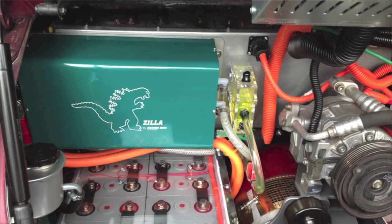One of the drawbacks of doing a conversion is that very often you end up with extra gauges on the dashboard that are not connected to anything. To that end, I volunteered along with my friend Deb to help Kirk get this running smoothly and more integrated. We have a BMS in the car — an Orion BMS — that reports the state of charge on the CAN bus and also reports cell temperatures. We also have a motor temperature sensor built into the case of the Warp 9-inch motor. Deb and my goal has been to get those signals displaying on the dash.